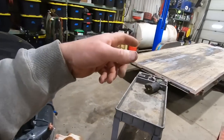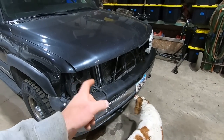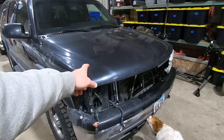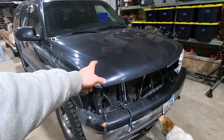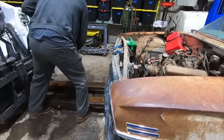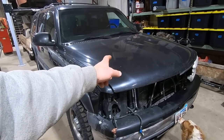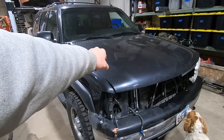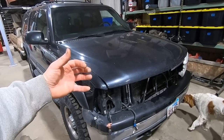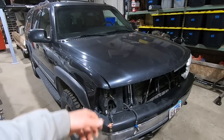The reason I got the car trailer in here is we're gonna back the car trailer up. We'll probably take the bumper off first. We're gonna pin it against the frame, and then we're gonna kind of do the tree chain thing, come along like we did on the Impala. On the main channel, but we're gonna tie to the core support with the winch, and we're gonna use the trailer to straighten that out. That way we get a nice controlled pull instead of just hooking it to a tree and backing up and ramming it, because then you kink things and it pulls it too far.